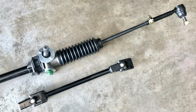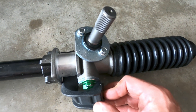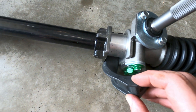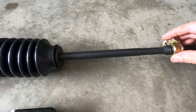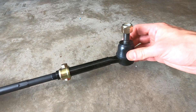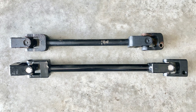It's built as a direct replacement for the power steering rack by using the same mounting points, the same rod end tapers, and it comes fully assembled for easy installation. The rack itself is derived from the Mark 1 Volkswagen Rabbit, the tie rods are sourced from the Volkswagen Scirocco, and the tie rod ends are borrowed from the 1983 to 1986 Toyota Camry. The intermediate steering shaft features spline connections attached by some nice thick welds, and it's about 2 inches longer than the factory power shaft.